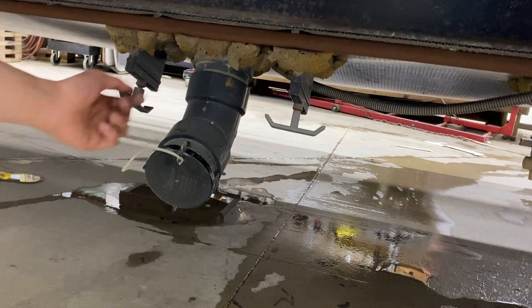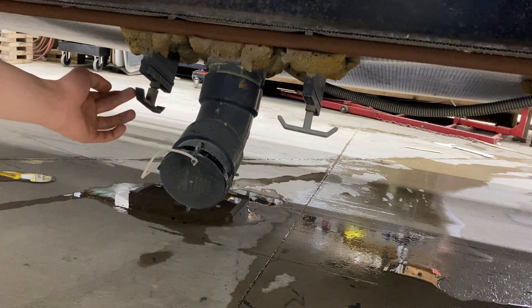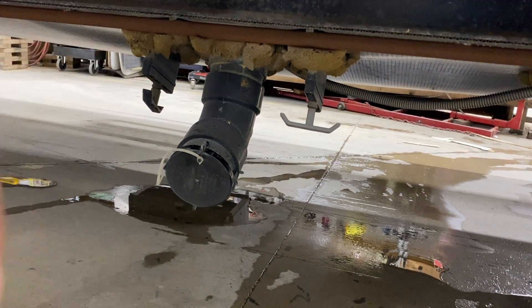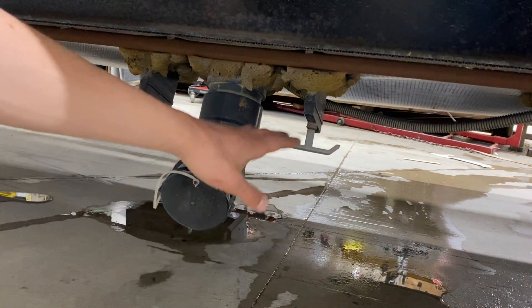On the left you've got a black valve, on the right a gray. Your black valve controls your black tank, which is filled from your toilet — typically your dirtiest water. You're going to dump that first, and once that's done, come over to the gray.